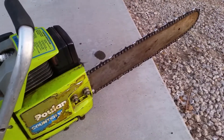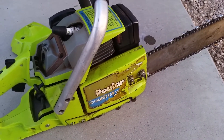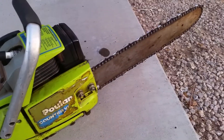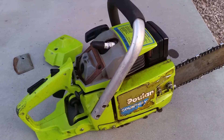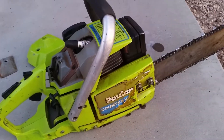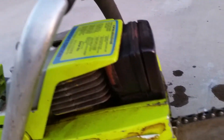It's cleaning out the lines, some of the junk. I run about a 40-to-1, 38-to-40-to-1 mix ratio. But these older saws — this is made in the late 70s or 80s, probably around 1980 — they just sound so much different. The mufflers were just mufflers; they weren't restrictive like the new ones with the EPA.